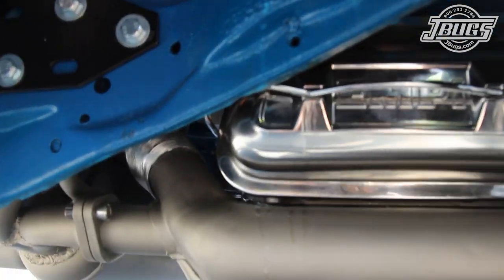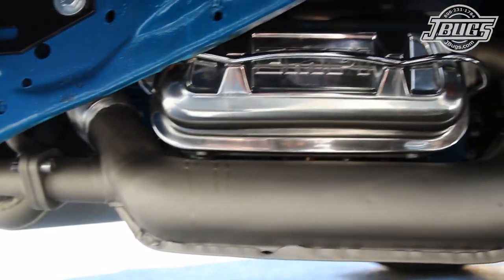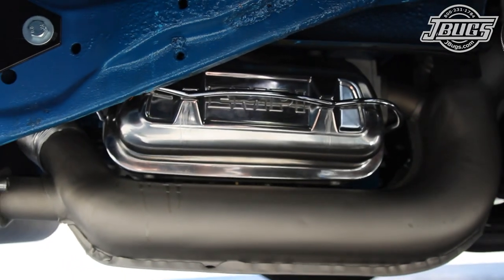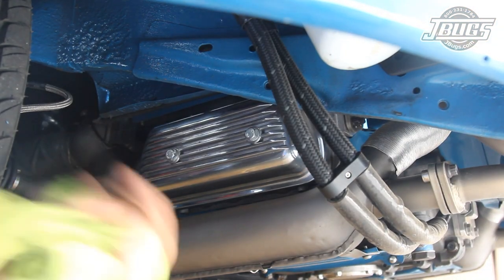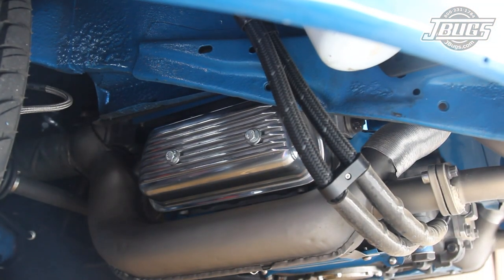The additional run time while we were adjusting our fuel pressure revealed that our valve covers were leaking a little bit too much to our liking. So after swapping in new gaskets didn't solve the issue, we installed a pair of bolt-on valve covers, which have no problem clearing our ratio rockers and seem to have solved the problem.